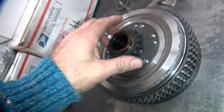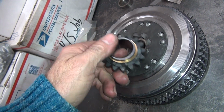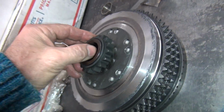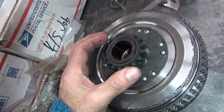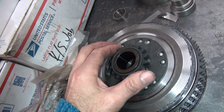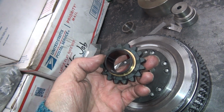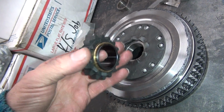Okay, sure that works. Now, when this is not concentric on it, like I've seen some of them, then this here will start rubbing on the side of the bushing here, and screw that up. And then the biggest thing is the ratchet's not on there square. Well, you can be away. There's a lot of room to be off center, but the problem is when it rotates, it doesn't stay off center. It goes in an elliptical pattern like this, and when you're kicking on it, you go around, it tries to pull it out sideways on you. That's when it pops out and gives you a sportster knee, which is a bad thing.